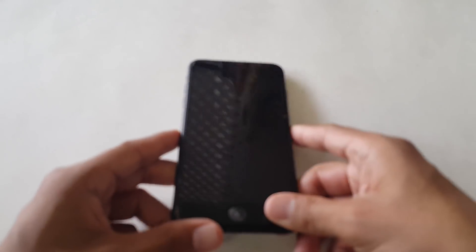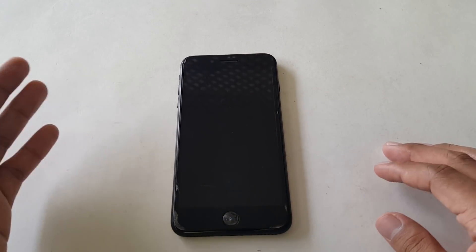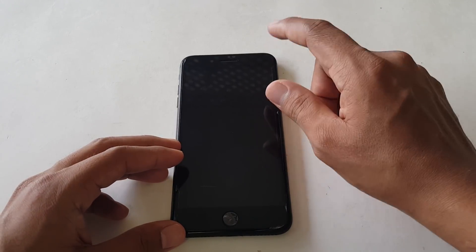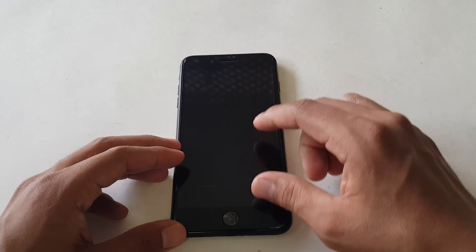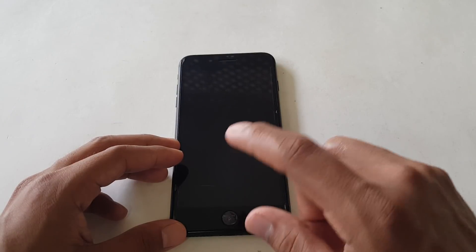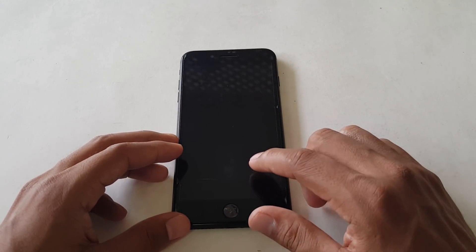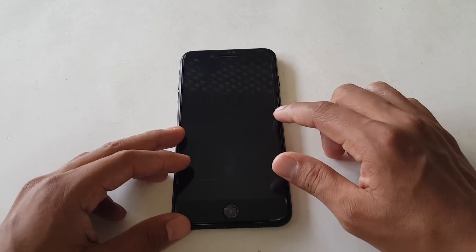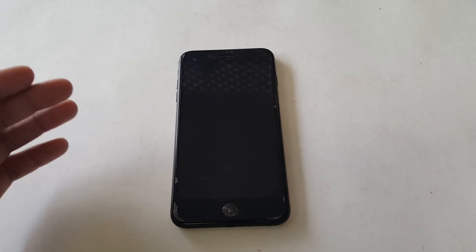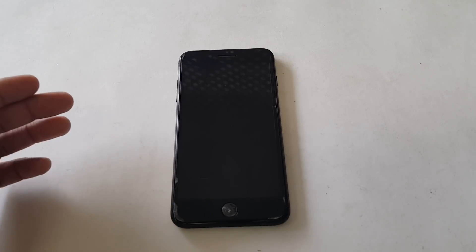If you have any troubles, don't forget to leave a comment in the comment section — I can try to help you out and maybe pinpoint what the problem is. If you just did a fresh repair, check the connection and it should definitely work. Again, if your home button was replaced, you're always going to have that issue until it's fixed by Apple themselves. But if you still have the original home button and everything's working, it's most definitely the connection. If you found the video helpful, don't forget to like and subscribe. Thanks for watching.